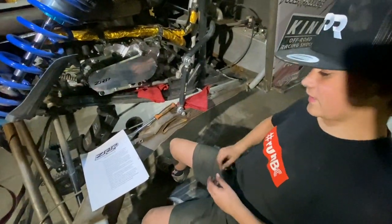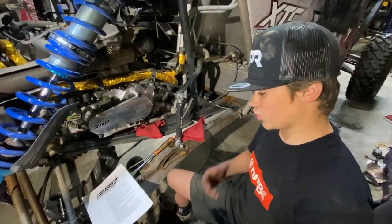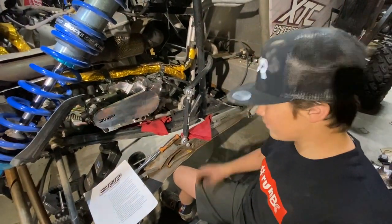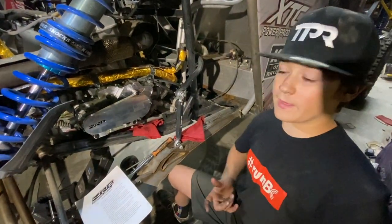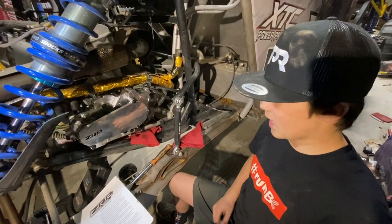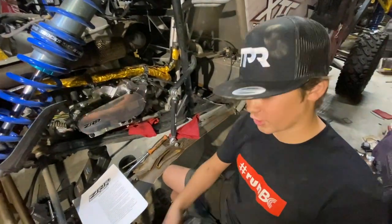We also love how ZRP did this little manual book right here — beautiful. I mean I'm only 13 and it was really easy to do this just by reading the instructions. They included everything you need to do and what product you need to use, which I think is awesome. The green wires connect straight to your battery so the alternator works, and the yellow one is just in case the alternator fails — it'll let you know. You don't have to run that if you don't want to, but the green one is definitely a need. That was the easiest install I've ever had to do. After you're done with your wiring, just put on your shock and your tire and you're good to go.